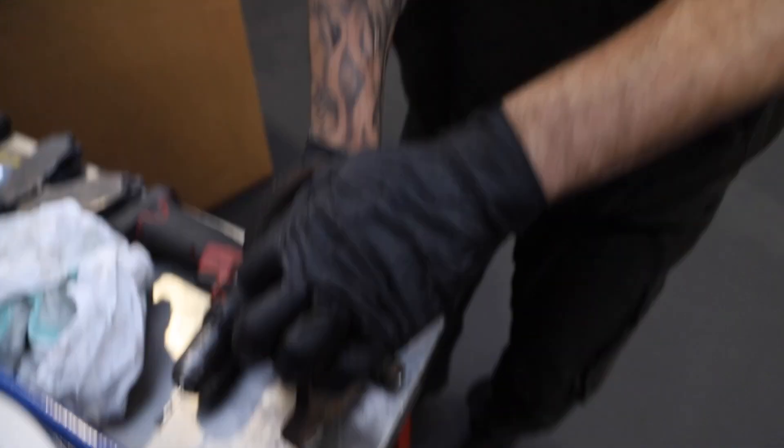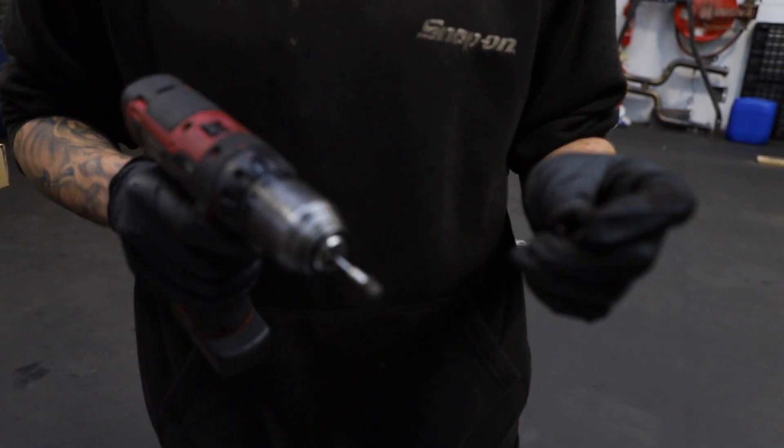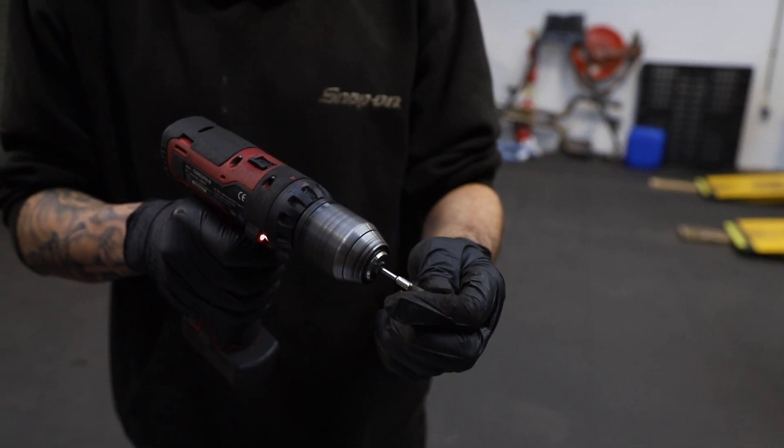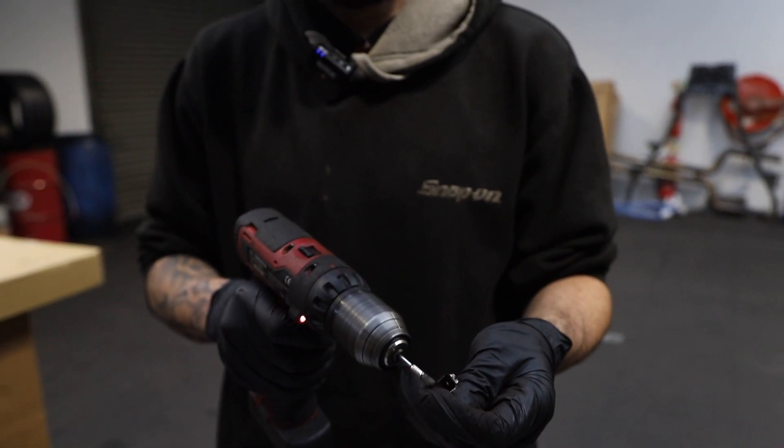When you've cleaned these up — and I clean the bottoms and underneath too — because what happens is the rust builds up, and when it gets hot the brakes seize, then you think your calliper's knackered and it's not. It's just rust. Cleanliness is the key to success. Sometimes they provide you with new ones with the brakes, but sometimes they don't.